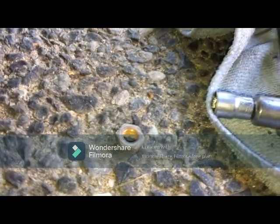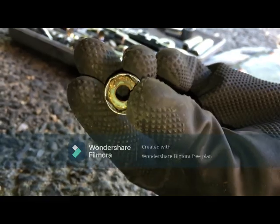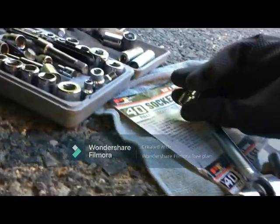I think I should cut the video here. Okay, so for reference, I have the old bolt here. Just using it for reference, take your 13mm socket. As you can see, it's a good fit. So take a 13mm bolt from the old starter, put that down, and then come up here.